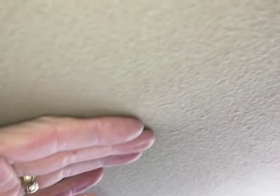Started around the perimeter of the headliner with the thumb screws, and I worked my way to the center, to the interior light. Wished I had a little bit more fabric to tuck into the under the light, but that's okay. I think it looks pretty good. The thumb screws worked out really well. They went in very tight. None of them broke, and none of them stripped out into the headliner.